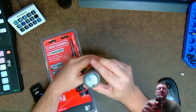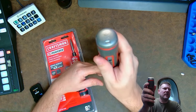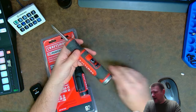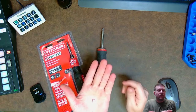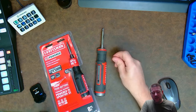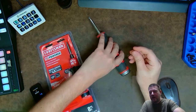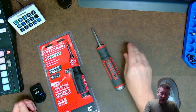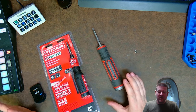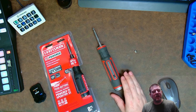It's dead because Craftsman made the mistake of using USB micro, and those things are so fragile. This one I fitted with a magnetic plug — it connects to a magnetic USB cable and charges that way, so I'm not constantly plugging and unplugging from the port, which will break it. Unfortunately I just don't charge it that often, but it does last a long time while charged.